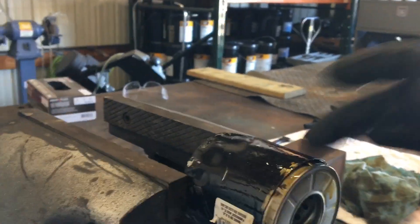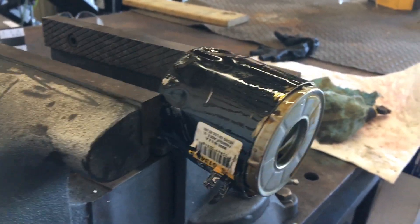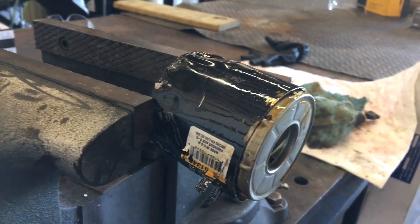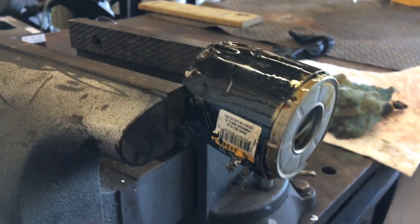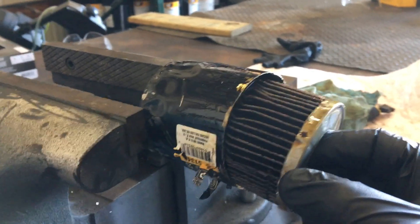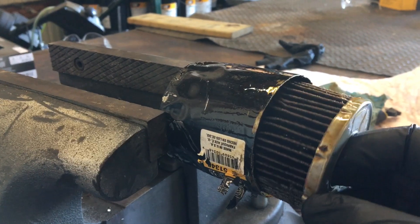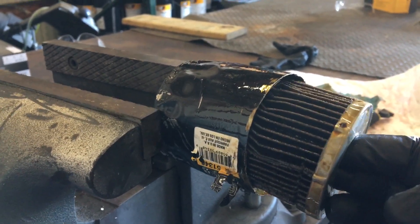What's up today folks, we got this filter head cut open. I like to do this after every oil change if I got time. We're gonna cut this thing open, pull out the filter, and cut some of this media off to see if there's any bits of metal or anything in it.